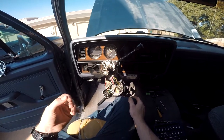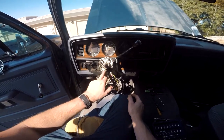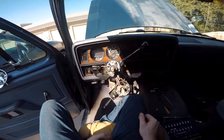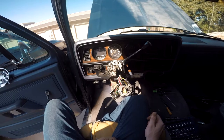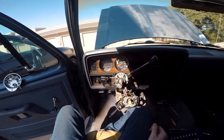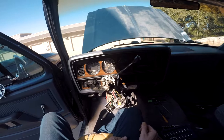That is how you tear all this apart down to the level needed for maintenance — to replace the blinker switch and anything else. Anything further from here with the steering wheel loose gets into pretty extensive stuff, like unscrewing the column to get to the U-joint. Thank you for watching part two of the teardown. Part three will show you how to put it all back together. Don't forget to check the description for all the tools you'll need, and I also have diagrams up on the blog. Like, comment, subscribe — and let me know what you want to see next.